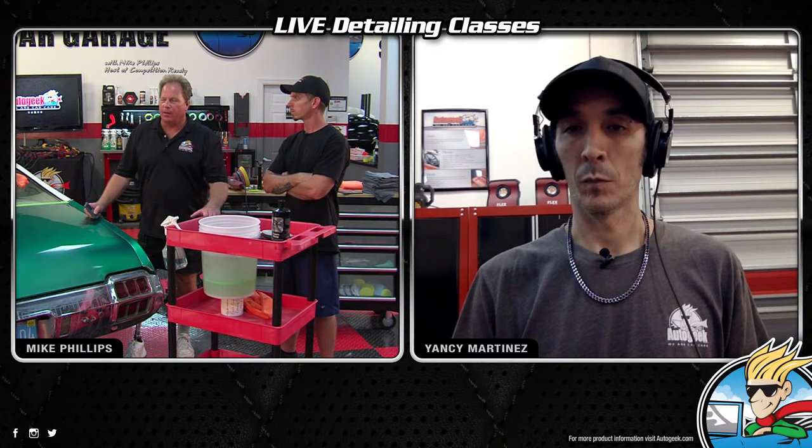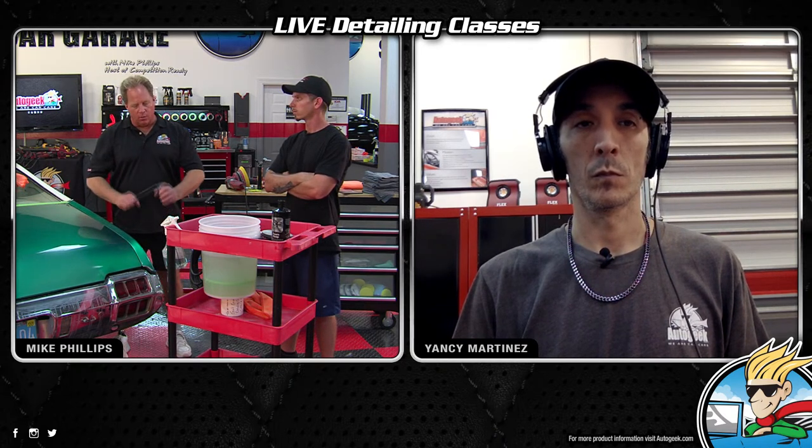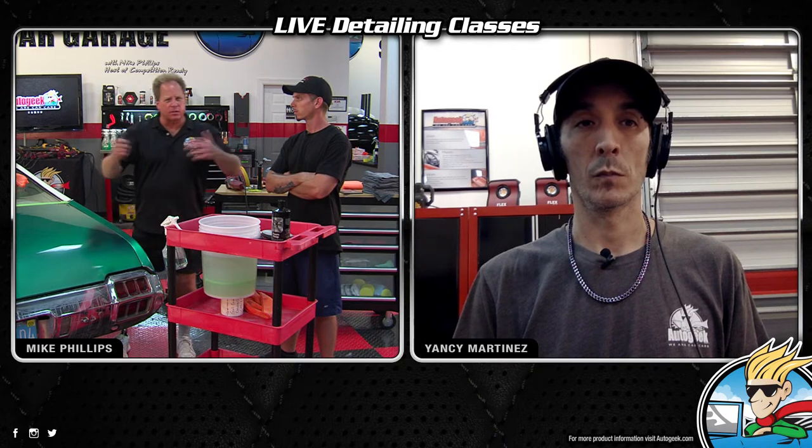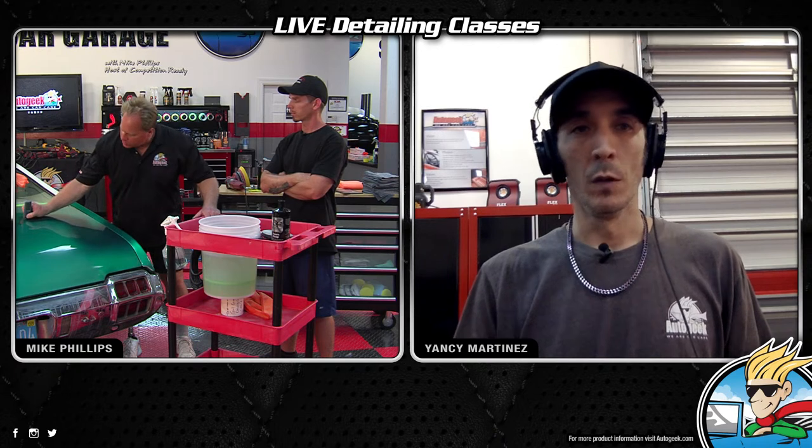Yeah. Well, we just measured your brand new car, and it's between 4 or 5 mils, and I would compound that, because I think all the clear coat's there. But as far as sanding goes, look, if you're working on a factory finish, if you don't have any experience or skill, you probably shouldn't be sanding on it. It's easy to sand on big flat areas. You start getting to these areas, and at some point when you go to get your sand marks out, you're going to go, whoops, and then it's all going to sink in, and you're going to go, dang. That's the uh-oh. I got to buy a paint job.